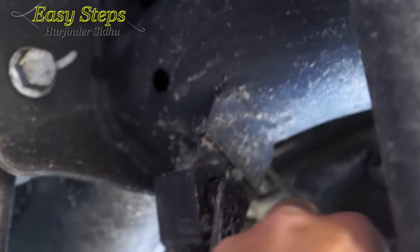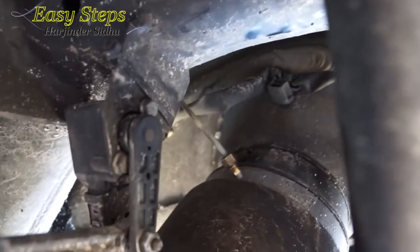Go behind the bag and look for the airline — the airline itself is right there. To remove this, you need a 10mm key. Twist the nut, and once you start hearing the air leak, let it slowly leak out. Once it's fully leaked, the bag itself should be soft and you should be able to push it in. Move the airline to the side.